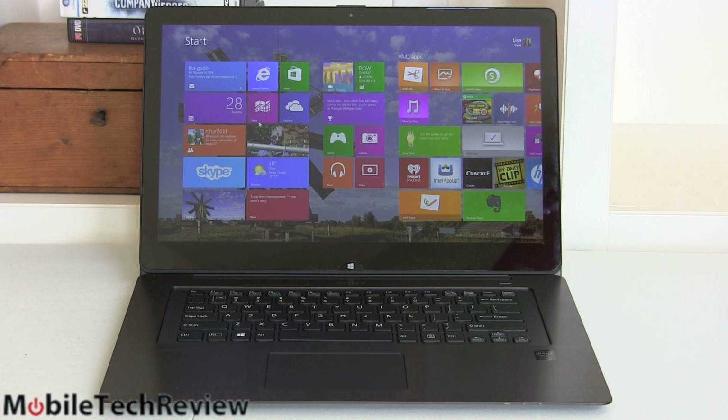We're glad to see Sony moving up to 8 gigs of RAM in there. And this one has Intel Wi-Fi, the 7260, single band 2.4 gigahertz Wi-Fi. That's what's confusing with that particular Intel adapter. There's a couple of different configurations. So single band Wi-Fi here. For the price, we'd really like to see dual band. It is a PCI Express card. You could actually swap it out for a dual band card if you wanted to.